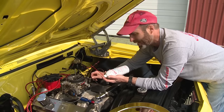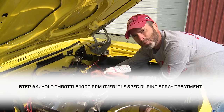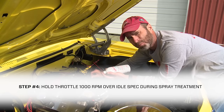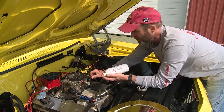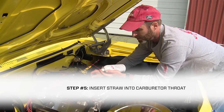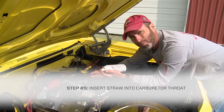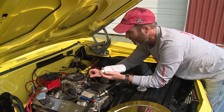We've got our engine running. The intake's hot. I'm going to run the throttle with my thumb at about a thousand rpms over idle to draw the Seafoam treatment. I just insert the straw into the carburetor's throat. I'm going to spray the whole can. It's going to take about four minutes. It's going to be running past the intake valve and through the chamber area.